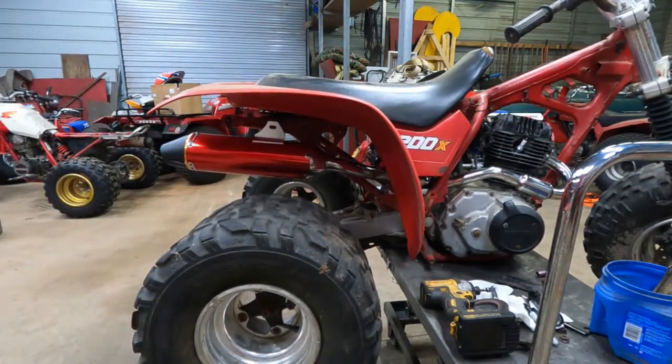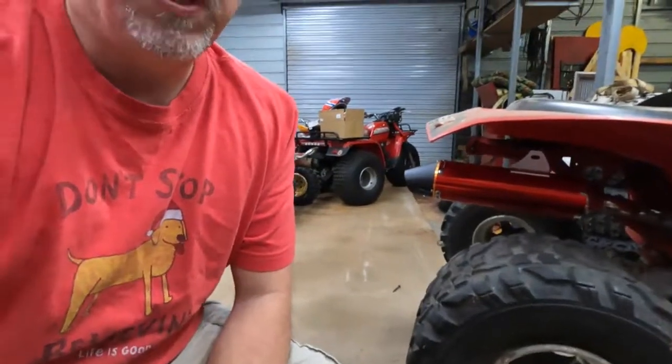There you go. First official test fit. I'm pleased with that now, fellas. Guys, I think that's a home run right there if you can weld. Now that welding is stainless steel. I use a MIG welder, not a TIG guy yet, but I use a MIG welder and stainless steel wire, and then 80-20 mix on my argon. I can weld anything with it, you know, stainless steel wise. It won't rust up. You can wire wheel it and kind of give it a finish on it.